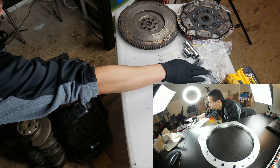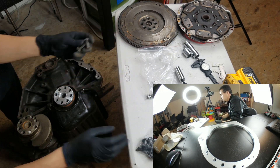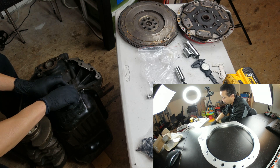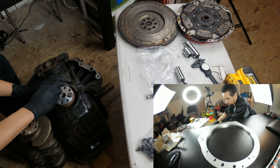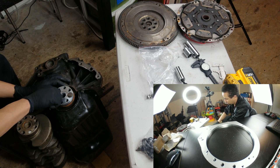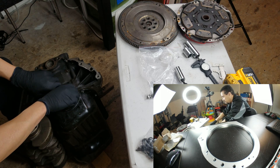See the thickness of it comparative to the other. Over here this bolt bag — standard bolts — just to show you regular sized bolts will go straight through the spacer. We'll probably end up having to get longer bolts for the flywheel, but no problems there. It seems to bolt right up to the A20 crank no problem, and that's how the spacer would go on.